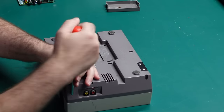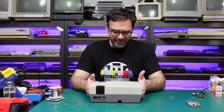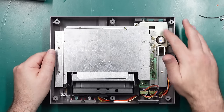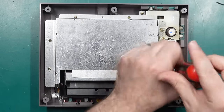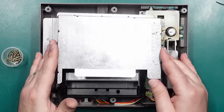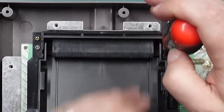We'll leave that off so we can give it a clean. I'm wondering if there's more creepy crawlies on the inside. The lid doesn't look too bad, there's a little bit of spiderweb, but that's fine. She's a little dusty around some of the ports, but all in all not too bad. And because it's a Nintendo there are another thousand screws to take out — thankfully they're all Phillips head, but if you ever need to disassemble a Wii, prepare yourself for screw hell. With our screw collection quickly growing we can now remove the top RF shield.